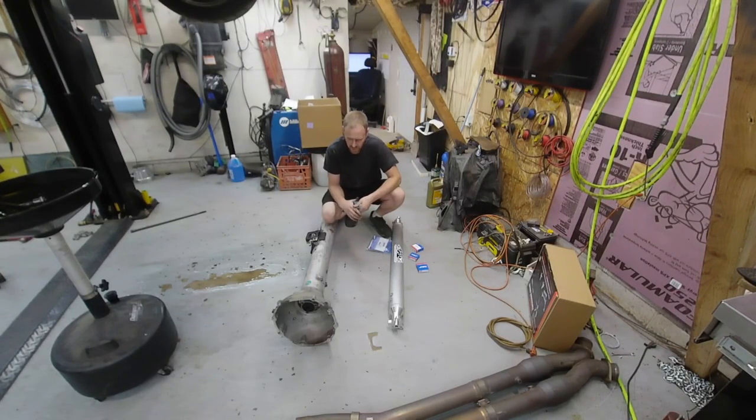Today on Face Performance Repair, we're going to do a torque tube upgrade where we get rid of the rubber bushings that are typically in there and replace it with a solid drive shaft — no rubber bushings, no bushings at all. It will be just the shaft, and then we're going to replace all the bearings as well.